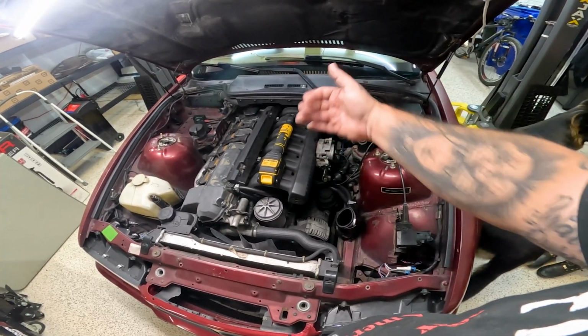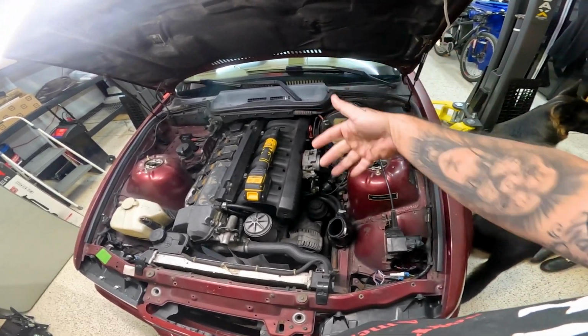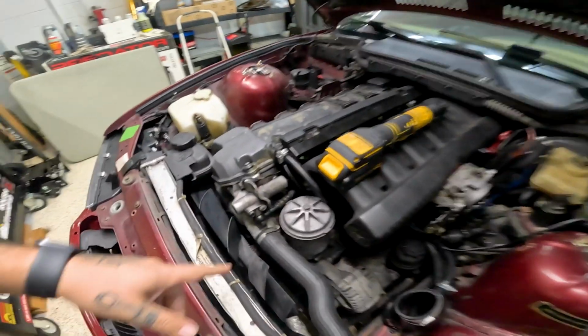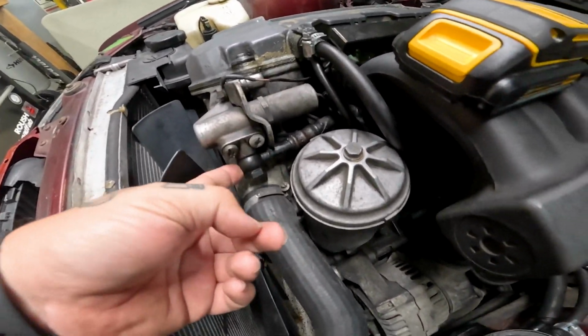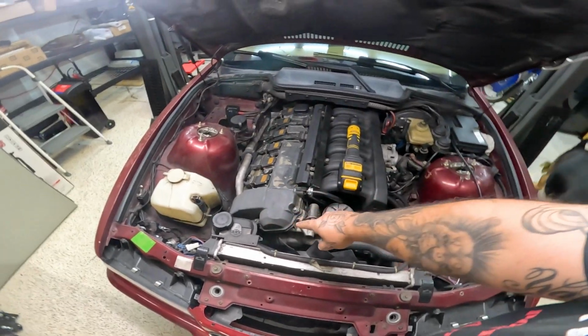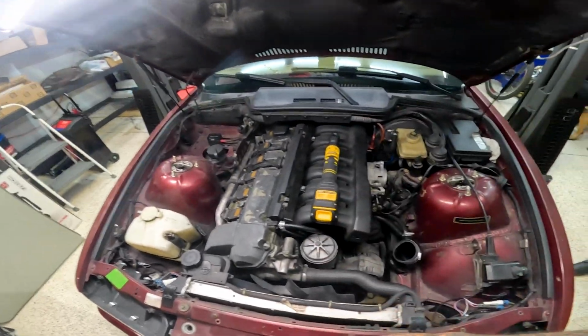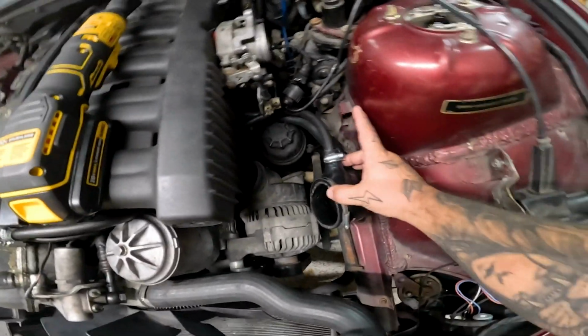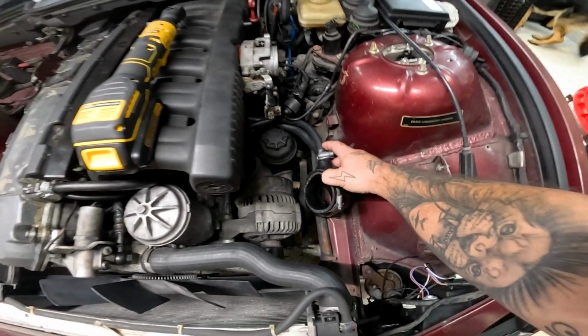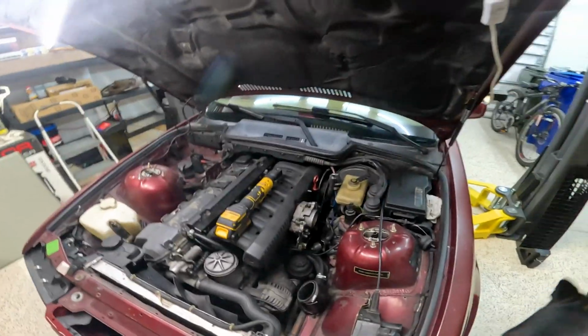So I got one over there. We're taking off the intake manifold. We're replacing the vacuum line there on the back. While we have the intake manifold off, I'm also going to be replacing the oil line here, and then after that we're going to be focusing on the upper valve train, redoing that gasket as well because it is leaking. We're also going to plug the blow-by line here, and then we're just going to go run this and vent it externally. Whole big table of parts.